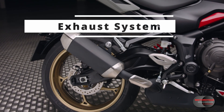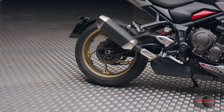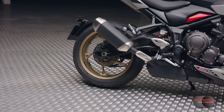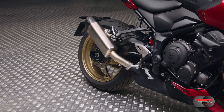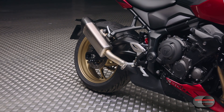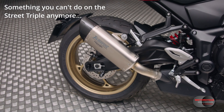I'm also going to consider what the company does from an engineering perspective and a business perspective with this whole platform — so deep dive, let's go. The first thing I want to do is praise the exhaust system. It looks like it's carried over from the Tiger Sport 800, and the good thing is that on this accessory model we can see there is a clamp on this OEM exhaust system, which means we can likely swap it for any third-party end can.